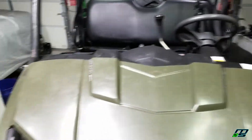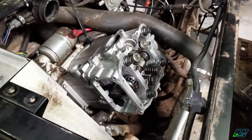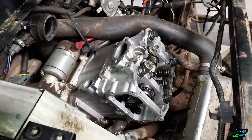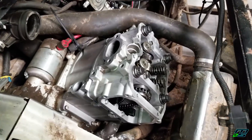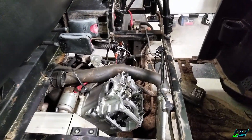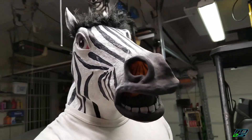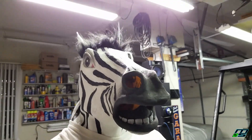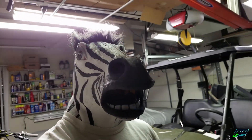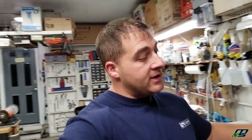Check it out — made some progress here tonight. Got the head on, cylinders on, looking nice and pretty. We're getting ready to do the timing but we'll wait for tomorrow because it's like midnight and I'm getting pretty tired. Tightening down these head bolts was a pretty weird procedure — you tighten them down in a pattern, then you loosen them, then you tighten them and go in quarter turns. That was definitely weird. Appreciate all you guys watching — comment, like, and subscribe. We're back today and we're about to do the timing on this thing, so let's get it done, get the entire top end all together, throw some oil in and see if it runs.